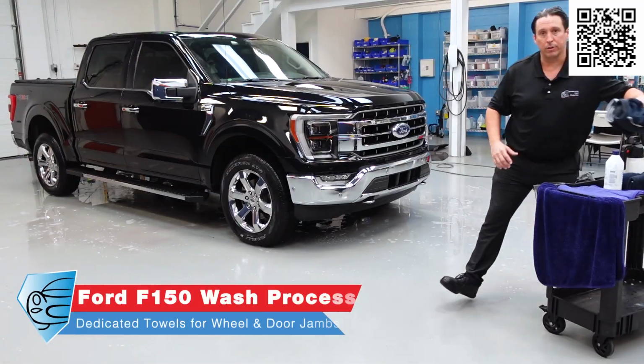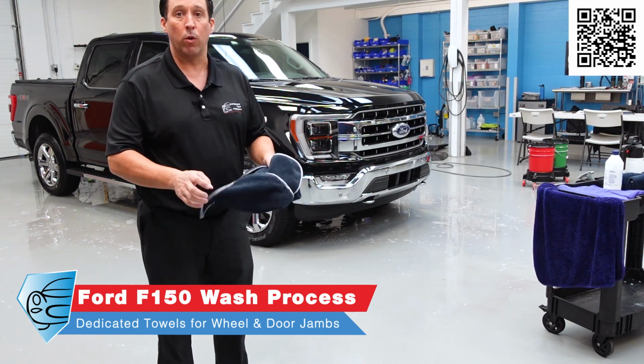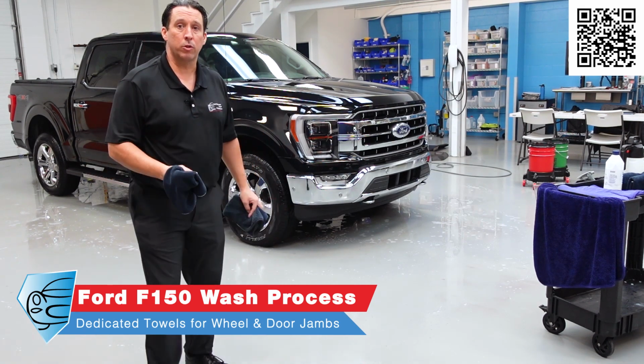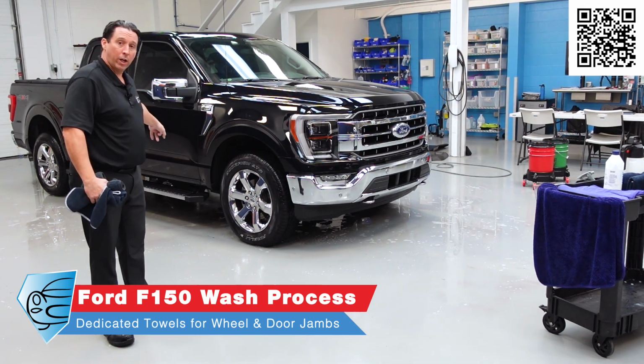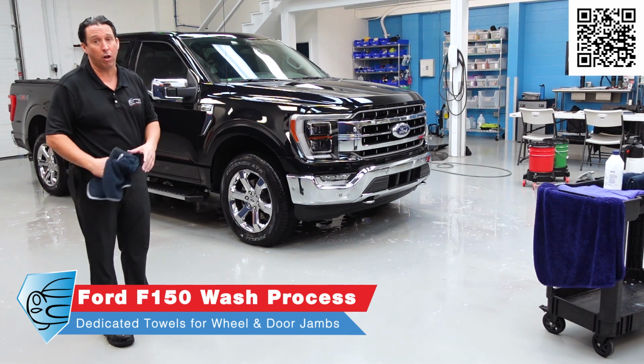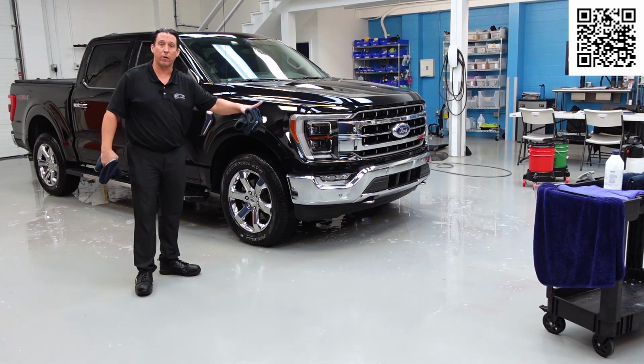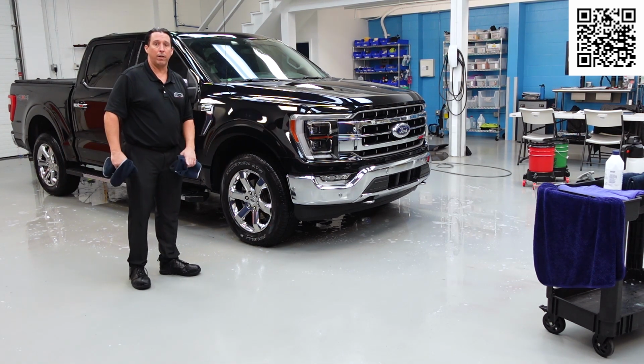We have a set of black towels here, and black because black looks cool. But these are dedicated for the wheels and the door jambs. Let's re-emphasize the point. Door jambs, lower rockers, wheels and tires, that's gonna be the dirtiest areas in the car, so we don't wanna cross-contaminate. I don't wanna take the towel that was already in the paint and come and touch the wheel.